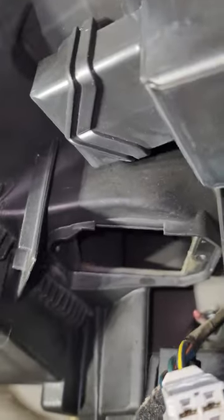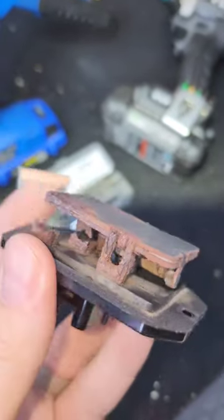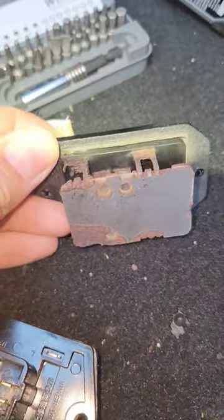What you do is come to the passenger side — it's right up under here. Here's your blower motor, and the resistor is right here. Just two Phillips screws and it pops right out. Look at how disgusting mine was — no wonder it went bad. Look at that, absolutely corroded. That's horrible. Anyway, here's the new one — see the difference? New versus old.